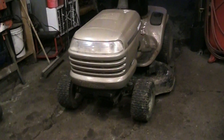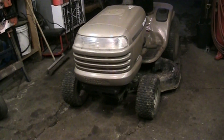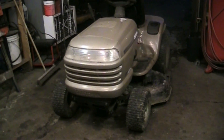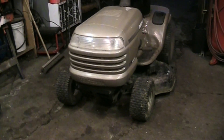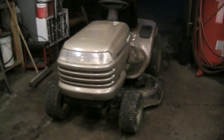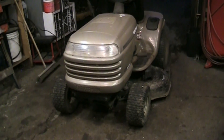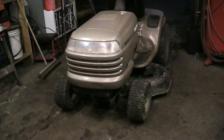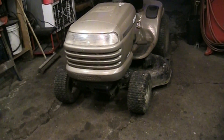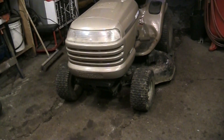This is a customer job. The customer recently had to put a coil on this machine after 20 years — the original coil finally had enough. He put a coil on, it fired up okay again, but the spark came back and it's blowing smoke like crazy, runs real rough, bogs down, blows blue smoke at the muffler. I popped over and had a look — there's an extra three liters in the crankcase that smells like gas. The fuel weight has overcome the needle in the carburetor. There's no fuel shutoff on this — there will be by the time I'm done. We're going to put a fuel shutoff in, pull the carb apart, make sure there's no debris stuck in the needle, change the oil out, put some straight 30 in, change the filter, and this one should be back in business.